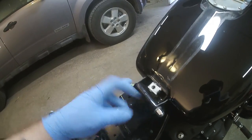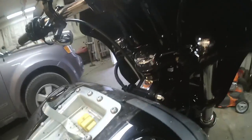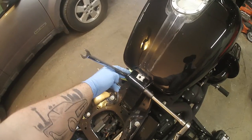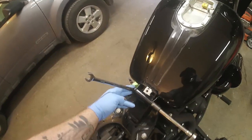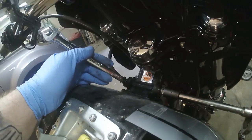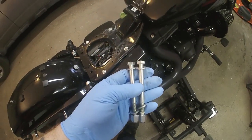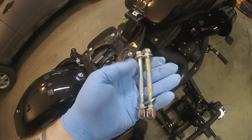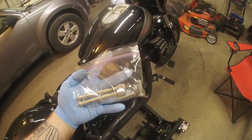We're going to remove the rear nut or bolt and acorn nut and washers, and then we'll remove the front ones. Just remember that the acorn nut goes on the right side. Mine is a 13mm on both sides for both of those nuts and bolts, and again that's a 13mm for the front one as well. Mine ended up being the exact same length and exact same thickness for the top and bottom, so don't worry too much about mixing them up. I'm still going to thread them together and toss them in the bag with those gauge bolts.